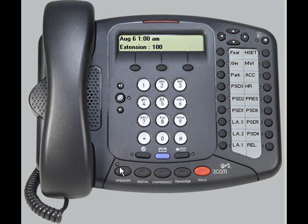The mute button will work the same for both a call on your handset or using the speaker function. To mute a call, simply push the mute button located here. A red indicator light will illuminate to notify you that the call has been muted. You will still be able to hear the caller, but they will be unable to hear you. To release this function, just push the mute button again and the light will turn off, indicating that the call is no longer on mute.